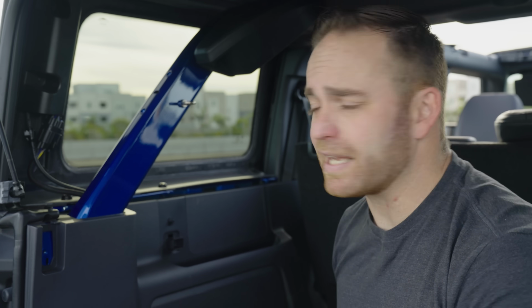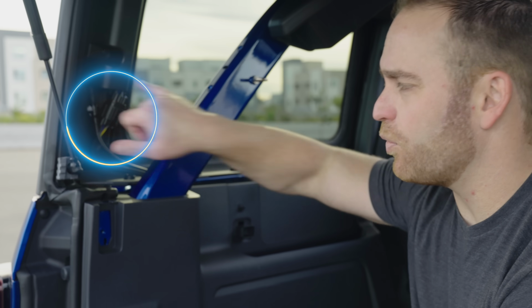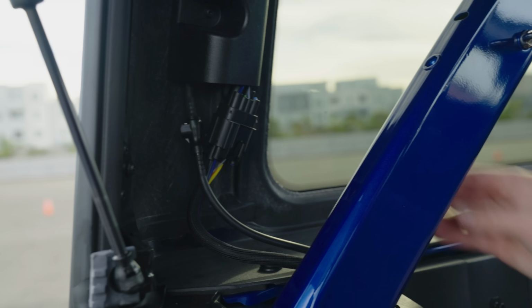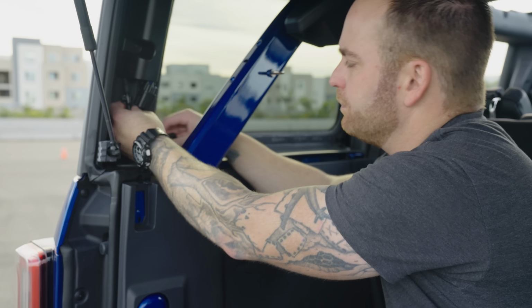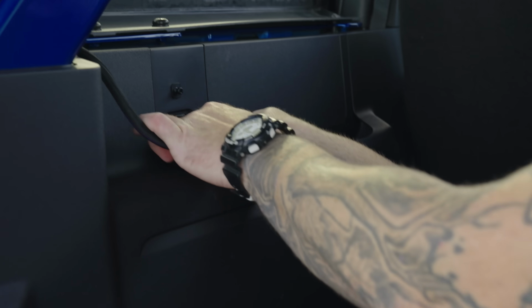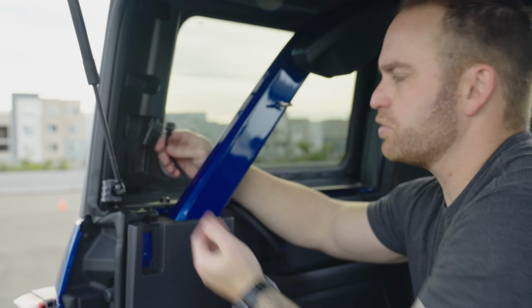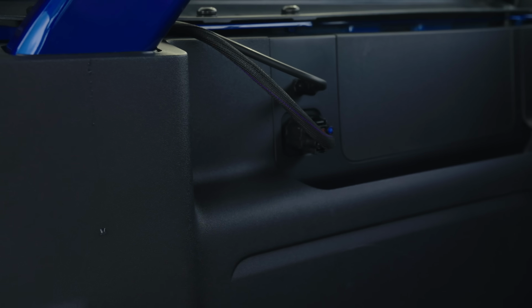So, beginner's mistake, I almost forgot, but luckily saw it right here in front of me, to take out the wiring harness and the hose for the rear wiper and washer. Those come out and then they go into a secondary slot over here for storage. So I'm going to take those out now. Just a simple pull down clip, real easy. Store that right here. And this one, real simple. Little drip of water, store that right there, and then you can safely take off the top.